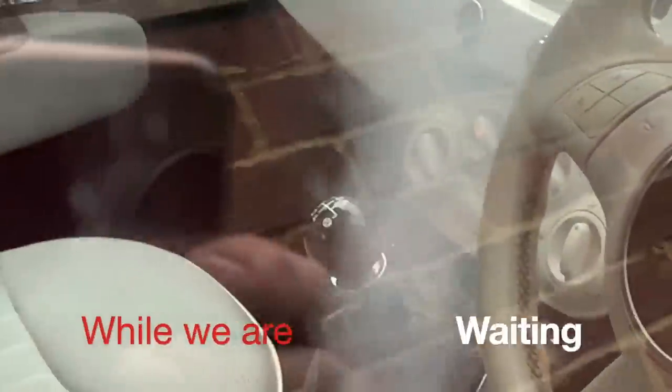Just giving the old aircon a bit of a blast through. There's a bit of a smell when the aircon's on, a little bit fishy. It's not much, it's only minute, but I know I've got the smoke machine, but I thought I'd use these. I've got a couple of these aircon cleaners. So you basically put the heater on full blast, put it on recirculation mode with the aircon on, leave it for 10 minutes to recirculate, and it cleans out and sanitizes the air conditioning.